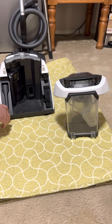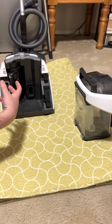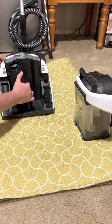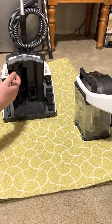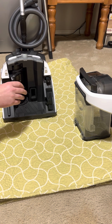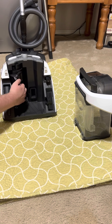The Miele has a sensor that can tell if airflow is restricted too much, which happens when the gore filter — the pre-motor filter — is clogged. It'll shut off and activate comfort clean mode, turning the machine off for about 15 seconds on its own, then start tapping the filter. It sounds like popcorn — it taps dirt off the filter so it falls to the bottom of the cartridge, freeing up enough airflow to restart.